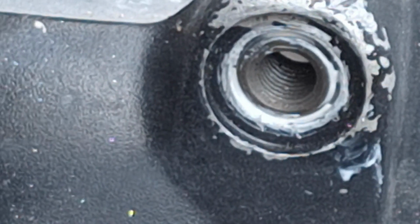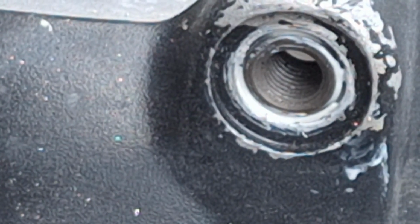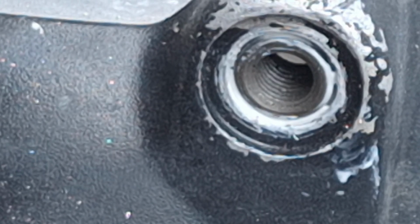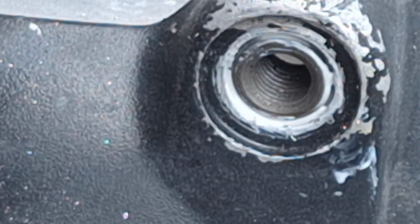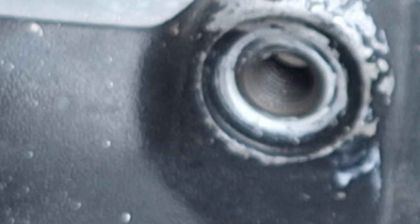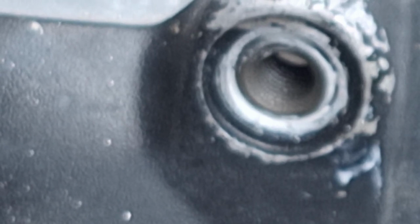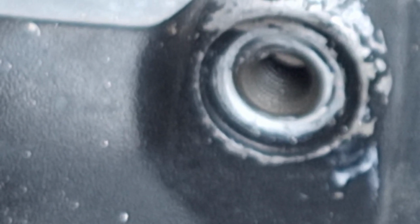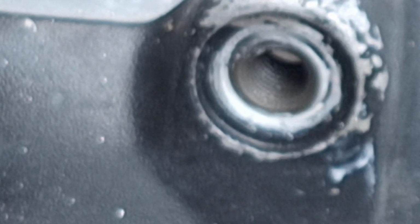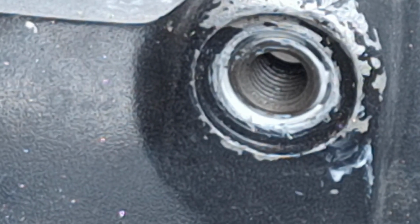Now, when you put the clutch cable in, don't be doing like some guys do and sit there and reef on it. You know, it's 5/16 24, but it's also hollow. So they're kind of easy to break, or I've seen people break them. They're not really easy to break, but I've seen people break them before. And that's probably how this got stripped out. Somebody was really reefing on it, and before the clutch cable broke, it tore the threads out of it. This is aluminum, and that's actually a fine thread, 5/16 24. So I don't know why they'd put that in there, but for whatever reason, that's what they use. So just be careful when you're putting those in.